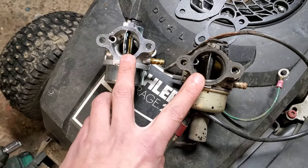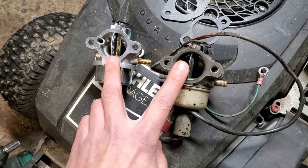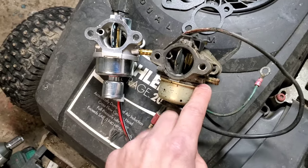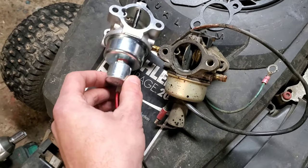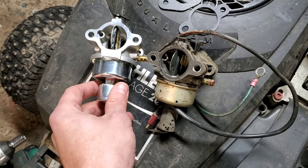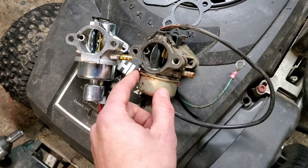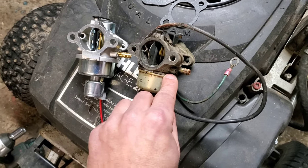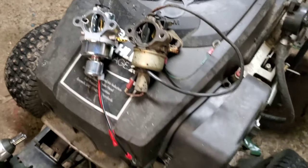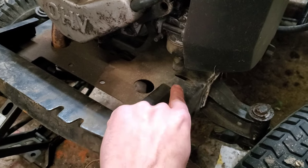Here is the side you'll see when you go to take the carburetor off — this is the choke side. See how this base cup comes up like this versus this one being laid in with a key in it so that it won't turn when you tighten it. That's because the gasket that's in here on these goes bad, they blow out, and they dump gas right straight onto the frame.